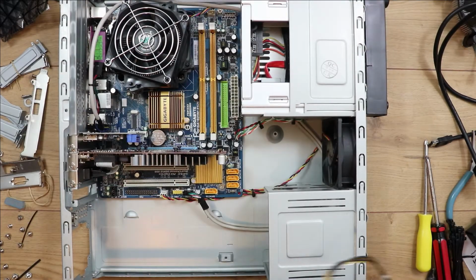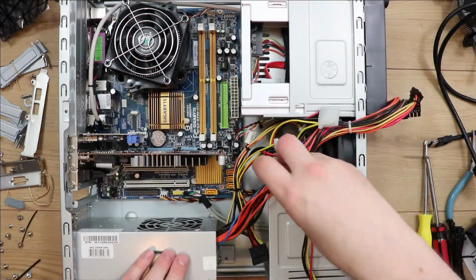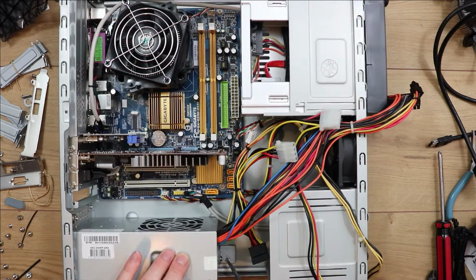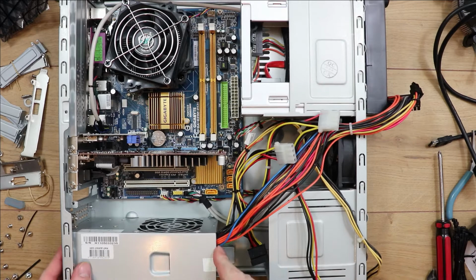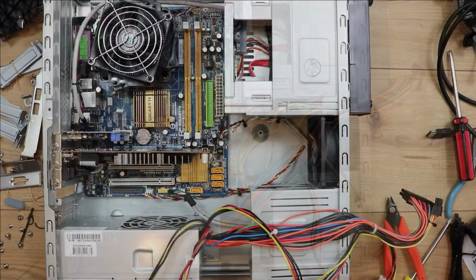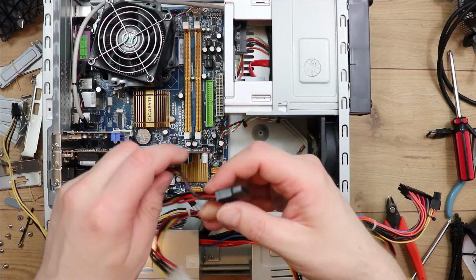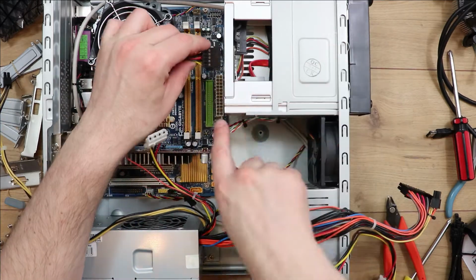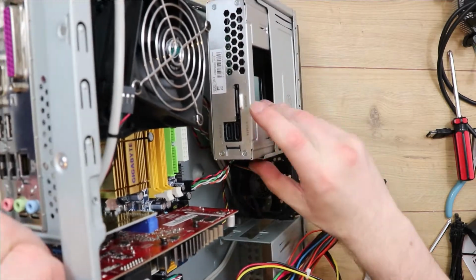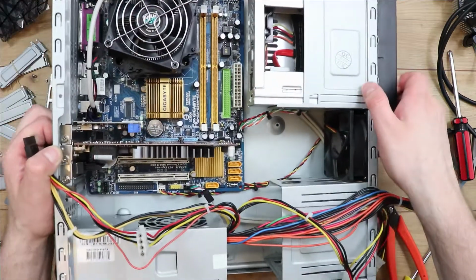And power supply. These supplies have this extra lug down here, and you just put a screw in there and it anchors the end, which is quite good because it stops it flapping around and straining the screw threads on the back. The bay only needs a single power connector for the SATA power into this, and then there's 2 SATA data connectors, one for the 3.5 and one for the 2.5 drive.